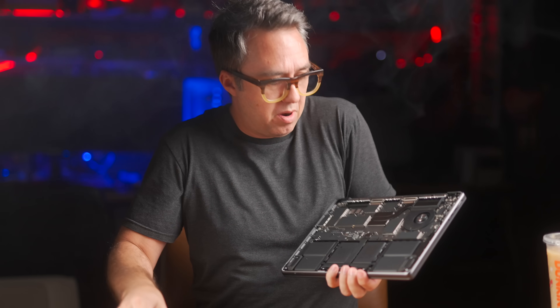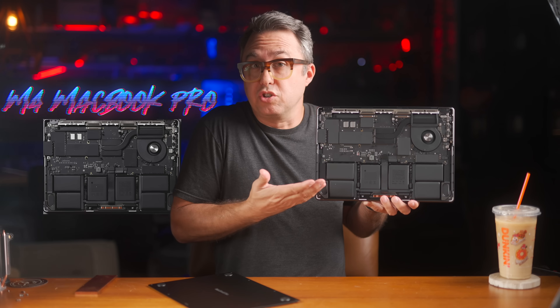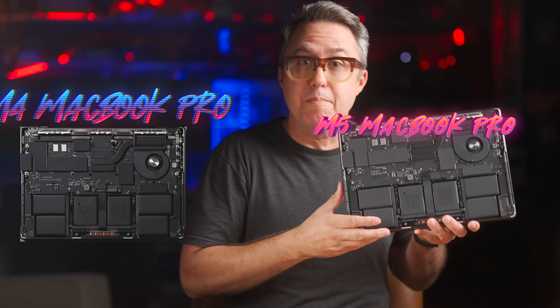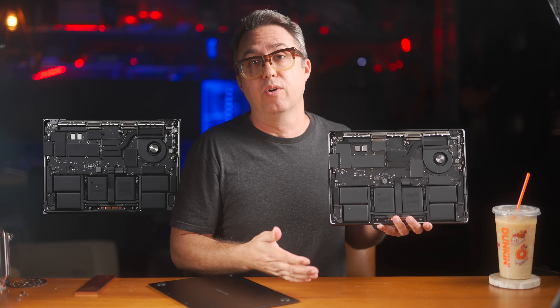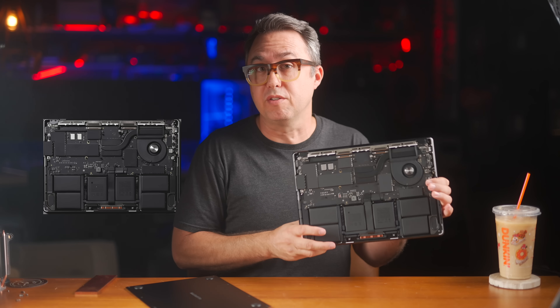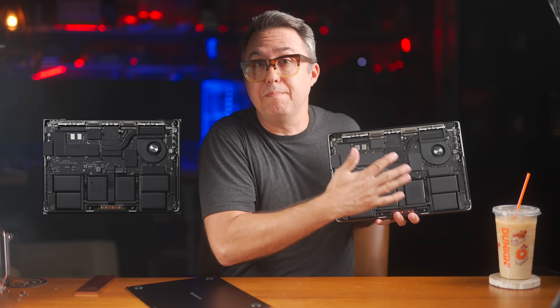This laptop has the same design as the M4 MacBook Pro — here I took the bottom off so you can see this one. I already gave my M4 back to Apple so we're going to use a picture to compare, but these are laid out exactly the same. Visually the same cooling system, but the MacBook Pro gives the M5 SoC more power — literally 30% to 50% more electricity than the M4 when maxing everything out. At full blast this thing pulls between 30 and 40 watts while the M4 MacBook Pro only pulls between 20 and 30 watts.